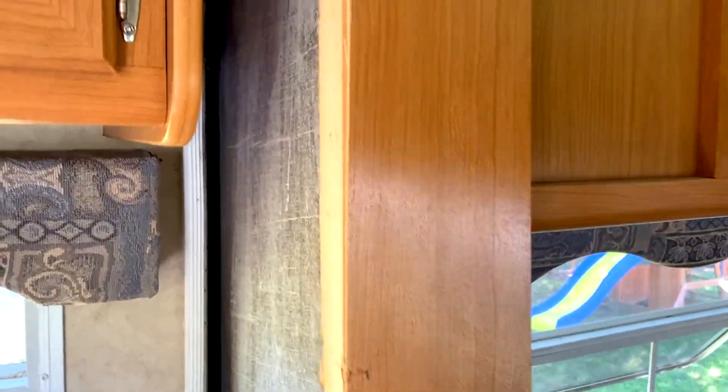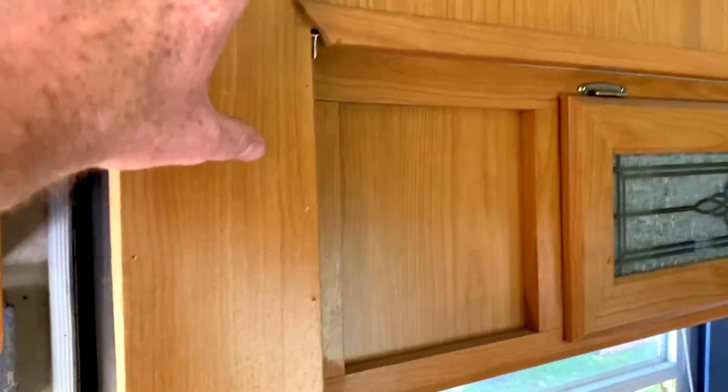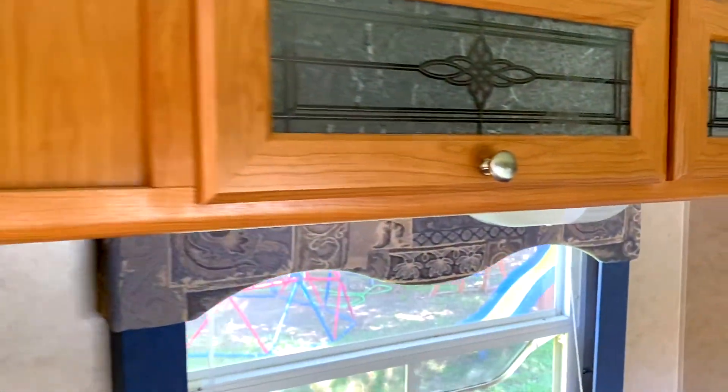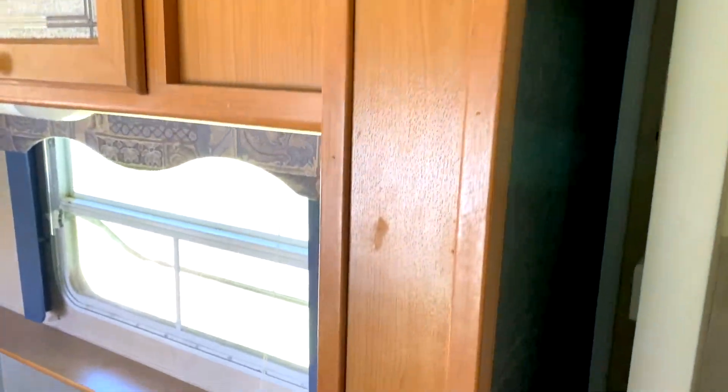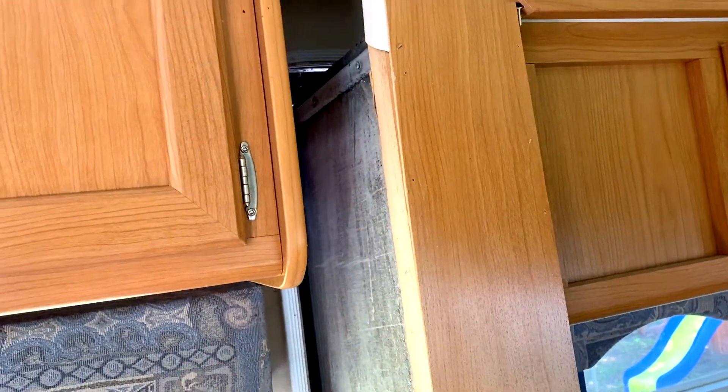I slid this back in as best I could with everything kind of ripping apart, and I was just looking behind this piece of trim — they've got some square-head fasteners that affix the slide-out to this two-by-whatever size framing. I'm going to go ahead and remove all this trim all the way around and take these off the inside face of the slide so that when I undo the motor underneath and unbolt everything, we can take this whole unit and slide it outside the RV. It'll also give me a chance to replace the gaskets where I think a lot of the water was coming in.